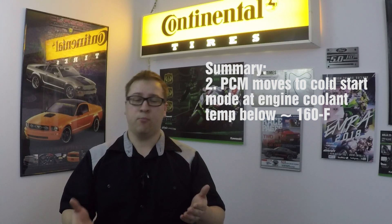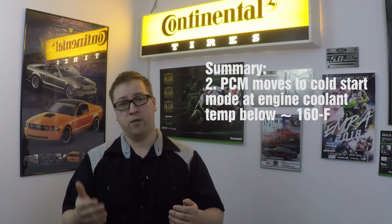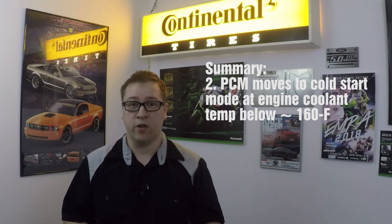Key takeaways: the PCM references engine coolant temperature and it's important to keep that where it needs to be, otherwise your fuel injection won't work correctly. Number two — update your thermostat, put in a slightly colder one, but test and adjust for your climate and use. You might get away with a 170, or be best suited with a 180. Make sure you don't dip below that 160-degree Fahrenheit cooling threshold — that's the biggest takeaway of this entire video. Number three — thermostats may not be the most glamorous topic, but there are a lot of newcomers to the hobby and it's important to educate them on everything we've learned. We've had over 25 years to study these vehicles, so it's important to share that. Thank you for joining us — please like, share, and subscribe, and I'll see you next time.